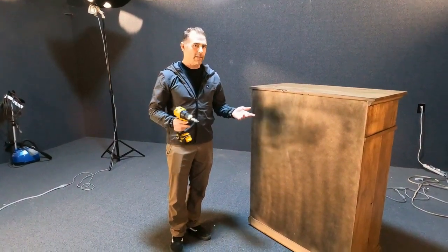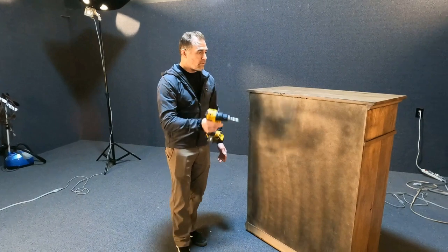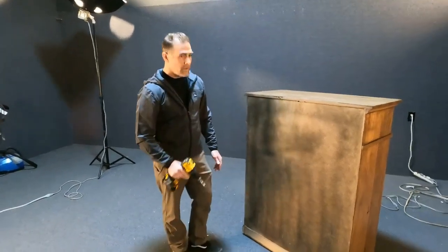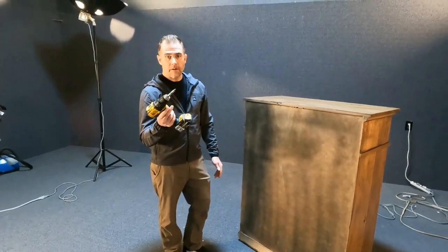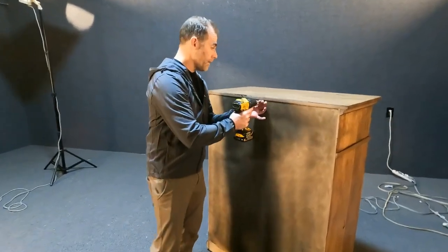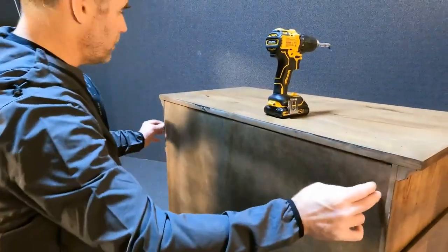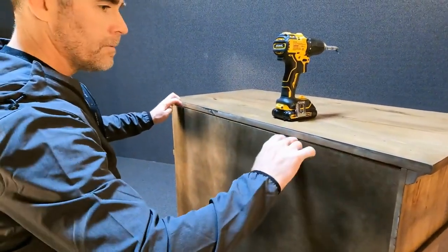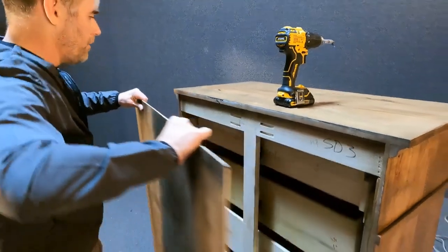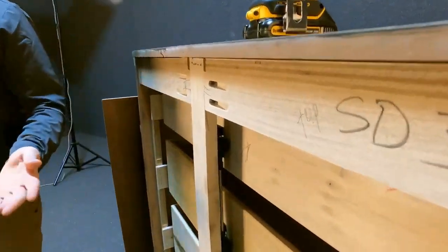In the event that you need to access the back of the cabinet, access the interlock via the back, and simply remove the Phillips head screws. Now in this case, I'm using a handheld driver. You could use a hand tool as well, a hand Phillips. We just remove, in this case, the final screw. Pull our back off. Now we have access to the cabinet.